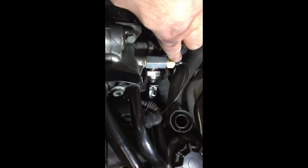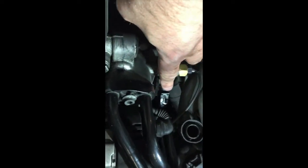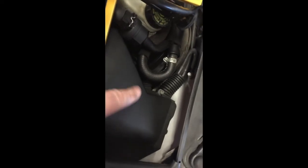Here's the finished product — temperature sensor here, oil pressure here. I've created a wire cover that comes down, zip tied here, zip tied here, tucks in. The temperature sensor wire comes in here and splits off following the same path. The plastic cover goes all the way up for the oil pressure sensor, and on this side we come in neatly, then find a place to route through the driver's side firewall.